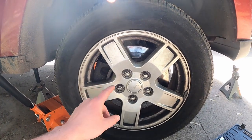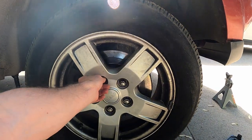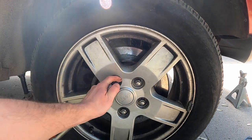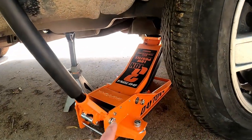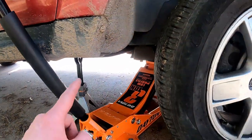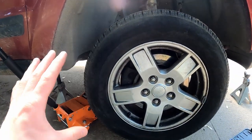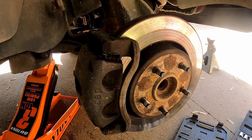The first thing we're gonna have to do is break our lug nuts loose and remove our wheel. These are a 19 millimeter on this Jeep, so just go ahead and loosen those and then remove the wheel. I want you guys to see this — I've got the jack as a backup and a jack stand actually supporting the vehicle, so I'm not getting under this without a jack stand. It's a big deal.